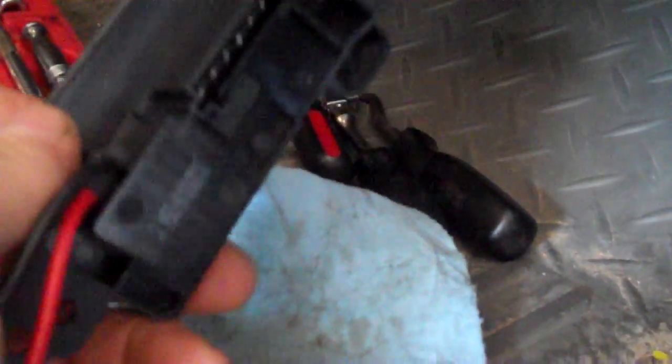That blister is what caused you to not be able to unplug it unless you really take stuff apart and break it the way that I did. You can see on this side it's got just a big cavity on it. So anyway, you can order a new plug and splice all 7 wires, and that's not any fun. But with this one, the resistance is going to be lower. It's not going to get hot like it used to. We're going to rock and roll this one in the meantime while we have that new plug come in that's been on order. It costs almost as much for the plug as it does for the resistor. It's about 40 bucks.